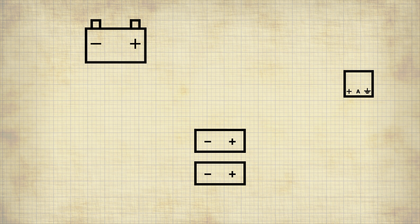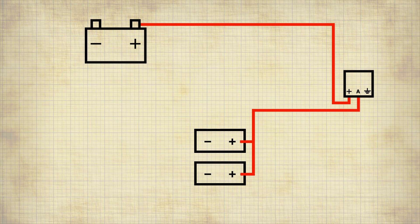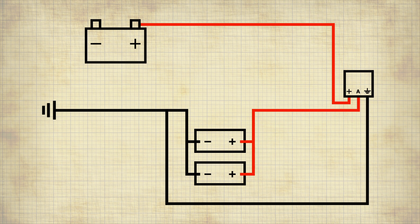Here's a look at the circuit. What we did is go from the positive terminal of the battery to the rocker switch where it has the positive sign, then from where the A is for current to the positive side of the heating pads, then from the negative side of the heating pads over to the ground wire that I ran from the engine ground. The ground part on the rocker switch connects there too, and that's what makes the LED light up. Thanks for watching — put in the comments things you think would help make it better. Thanks, bye.